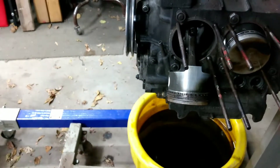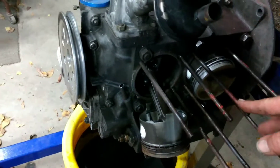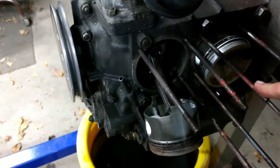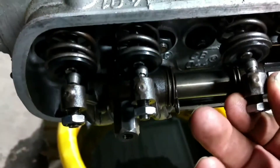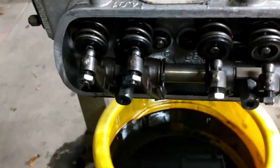I wanted to look at the engine and all the parts. I believe it was number two cylinder - I forget which way it was sitting on the floor, but anyway it was on that side. So I popped the valve covers to check it out and the intake and the rocker were all the way adjusted. I've taken them loose now because I've got the other side apart, but anyway the intake was adjusted all the way out and the push rod was just laying in there. I'm like, well, that's why your engine was missing right there.